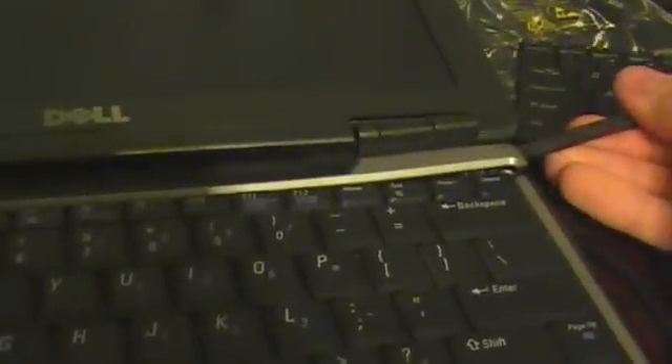Pivot the screen back all the way. Normally I use a screwdriver, but since I got this nice tool from Dell, go over here to this corner, get it under there and pop it out. There it is. Nothing wrong with that bezel — I guess they give it to you just in case you break the old one. Now take these screws out.